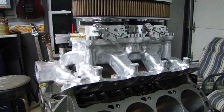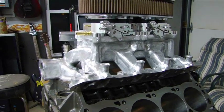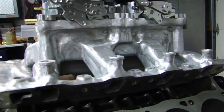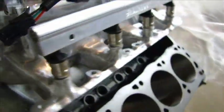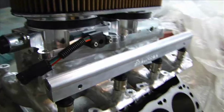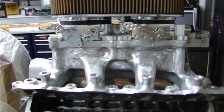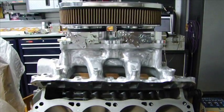Here is the finished manifold, just sitting on the block right now. The next step would be to bead blast and powder coat it. I have not done that yet because I am not sure what color I want or what color scheme I am going for in the engine compartment — I will do that when I get the motor finished. I just want to show you the billet spacer welded and blended in, and all of the bungs for the fuel injectors welded and blended in as well. I have one side with the fuel injectors mounted and the Edelbrock fuel rail — looks really, really cool. A lot better than just having two throttle bodies mounted on top with regular carburetion. Like I said, next step will be powder coat, which means bead blast first. I am working on the cylinder heads right now, so my next video should be putting the motor together.